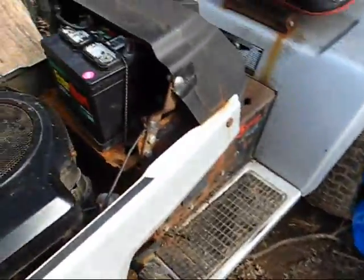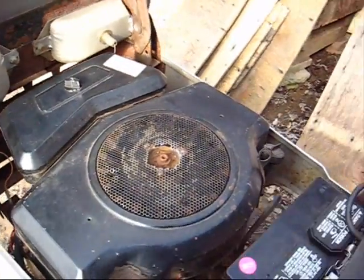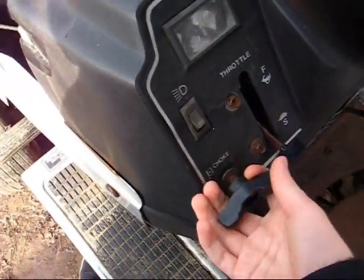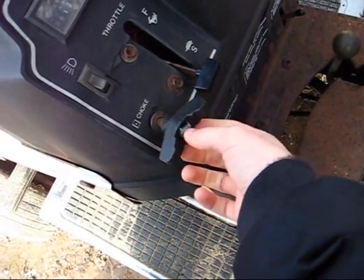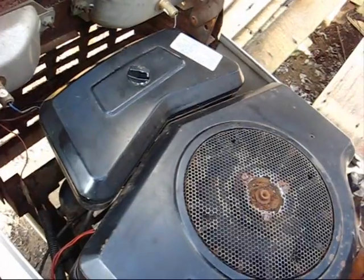The other problem was I filled the tank up with gas but the choke was stuck open. I have a temporary fix - a new choke cable is on the way along with some more parts. Basically it's spring-loaded: I pull it out and start it, then let it go gently. I had to do some carb adjustments too - the carburetor needed cleaning, and I actually took care of that about two months ago.